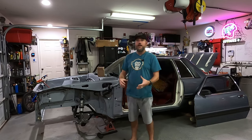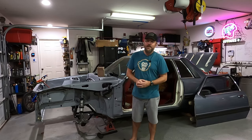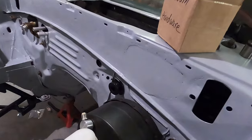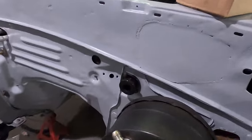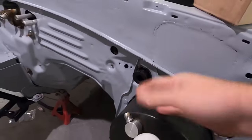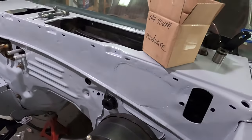I'm putting a T5 in here, so we have to put a pedal assembly from a T5 model Mustang. We also had to switch out the firewall adjuster. In some of my earlier videos I went ahead and put this in. Now this is where the clutch cable obviously comes out, loops around, and attaches to your transmission to disengage the clutch.